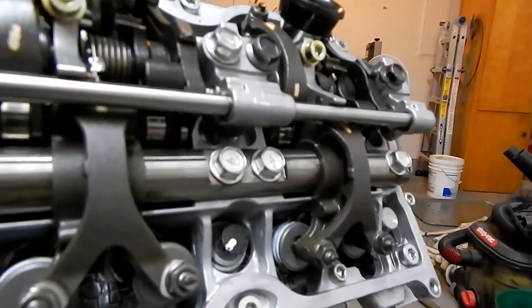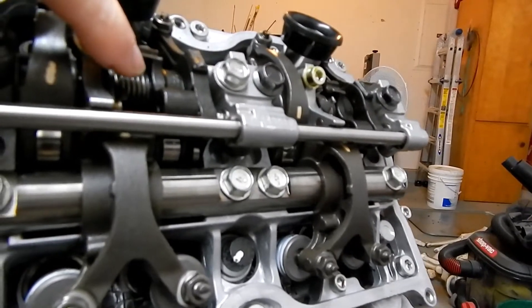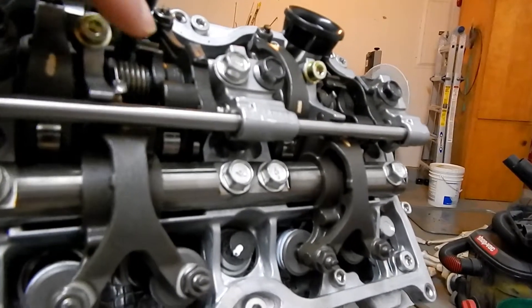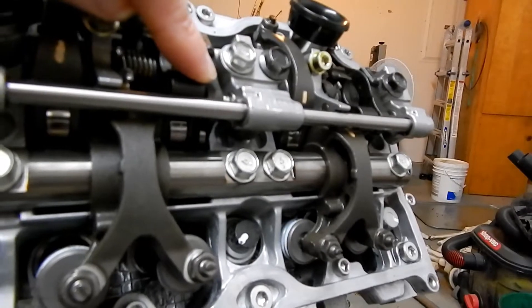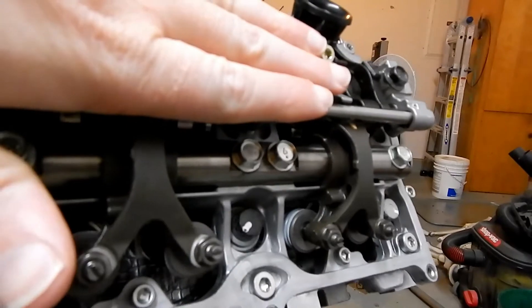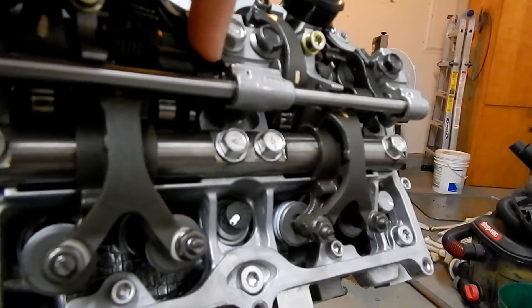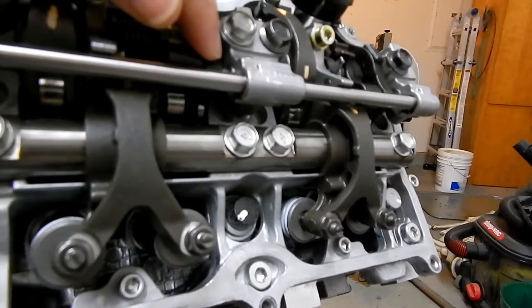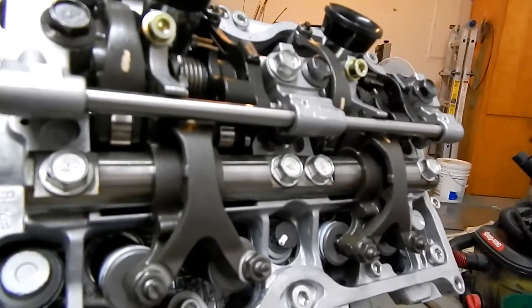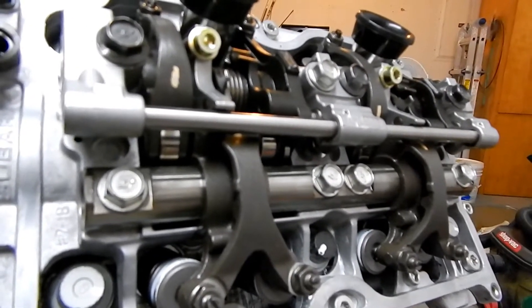This is actually the first overhead cam engine I've worked on, so this is a little bit of a new experience. I just wanted to point this out — if you haven't messed with the system before — you've got to make sure all these pins are in place. When you're actually installing it, you have to use quite a bit of force to push this down and then run the bolts in to hold it in place. You might need an extra pair of hands just to wiggle some of these pins around so you can actually get it flat and flush. It took me a little longer because I've never worked on an import ever.